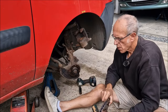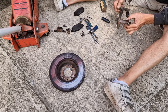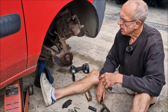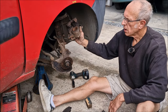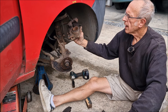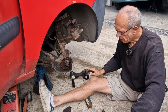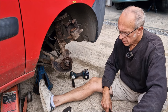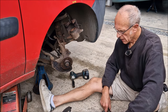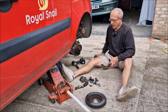Off comes the pad carrier and the disc — let's take a look at that. Oh, that's grim, that is actually, isn't it? That should get a good old clean. That is your noise — you're absolutely right, that's your noise, son. Everything else looking OK? Pads looking OK? Yeah, just pump that pedal out from here while I have a look at that piston. Push the jack under right down. The piston's going back. OK, that's not a problem — it's going back nicely. There's the problem. Do we think that that is what's causing the noise at the back? No. Well, it was worth a shot.